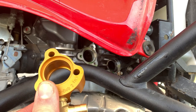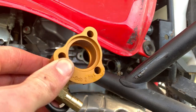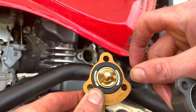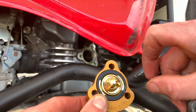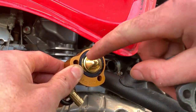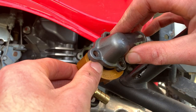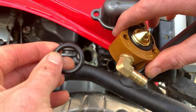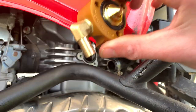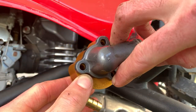Here's how this thing is going to work. Here's your new Thermobob 2 — looks great. It's going to sit in there a little cockeyed — that's normal. Take your thermostat with the spring going in, press it in there, and make sure you get the spaces lined up right. It looks just like the picture with these little spaces on the side. This gasket is for when the two mating surfaces go together, and then they supply you with a gasket that goes between the new housing and the head. Push that in, this piece goes on, and then this goes on.